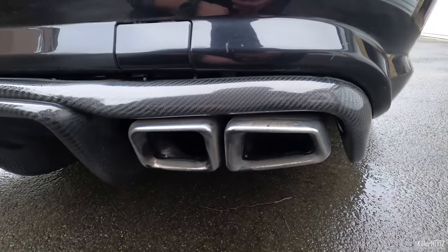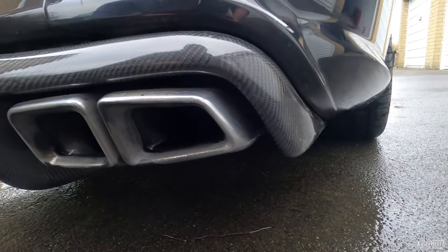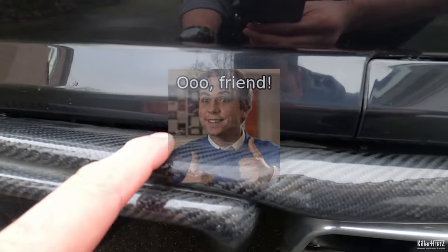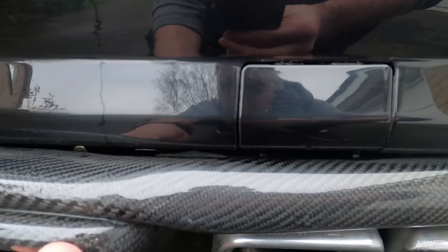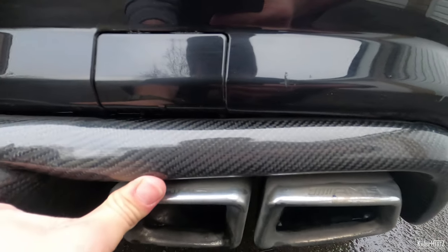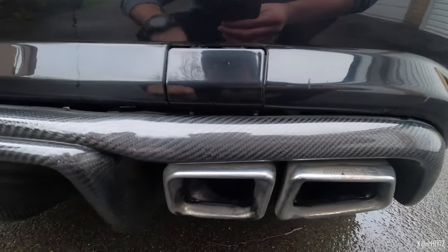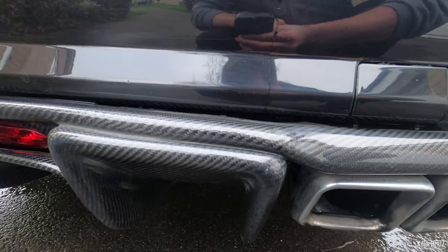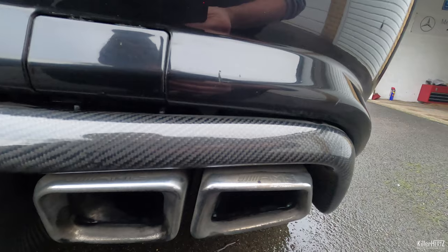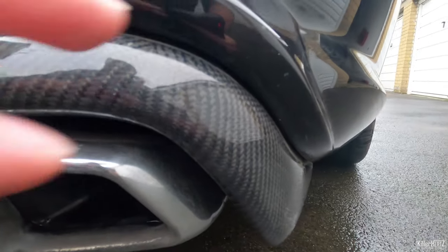Back on the car, I've reattached the bumper with the diffuser attached. This would have been virtually impossible to keep together without the help from a friend, so this part is definitely a two-man job. As you can see, although the diffuser is attached to the bumper there's still around a 5mm gap visible. If I press against it you can see the required final position. My plan is to fill this gap with sealant running across the entire length of the diffuser, which will keep it snug, in place, and most importantly safe.